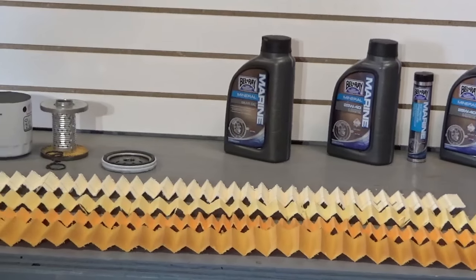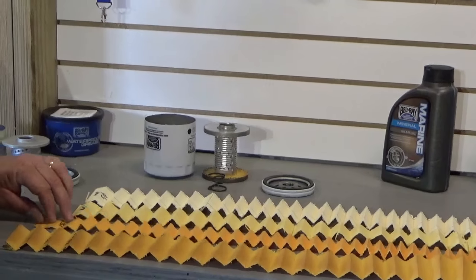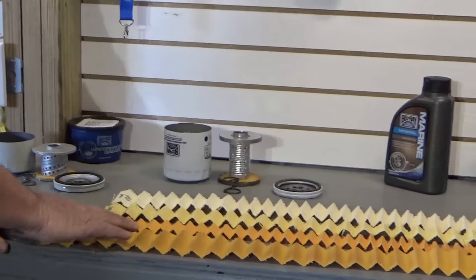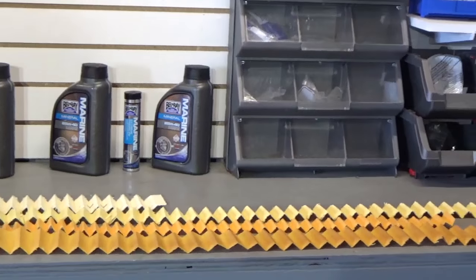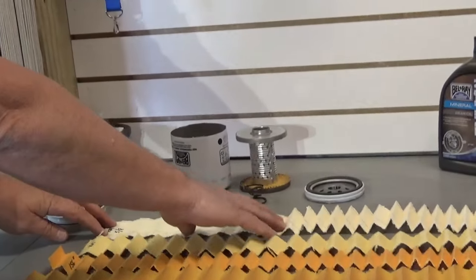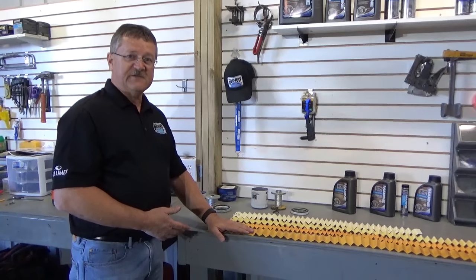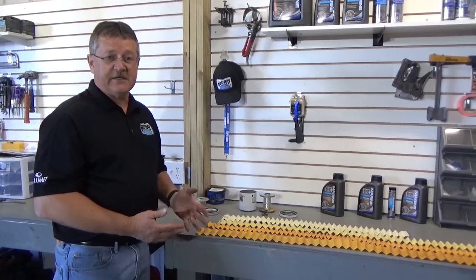The aftermarket brand we checked here — kind of in the middle. Stretching this out, the filter media is not as deep, the pleating is only a half inch, and the overall surface area on this measured 156 square inches. And of course then there's the Bellray — a little bit larger canister, three-quarters of an inch with nice deep pleats. This has a total surface area of 228 square inches. So with this filter you're going to have a lot better unrestricted oil flow — as much as 30% better dirt holding capacity — so you're going to get a longer service life. Plus the structural integrity: it has a burst pressure that exceeds 300 psi, which is far more than you're going to see in any marine application.